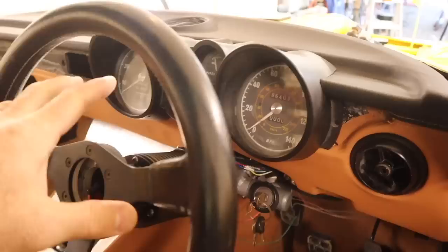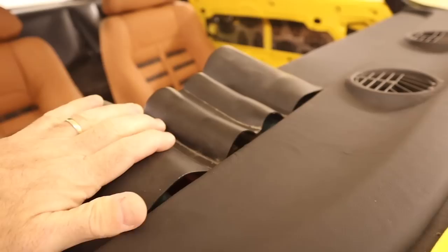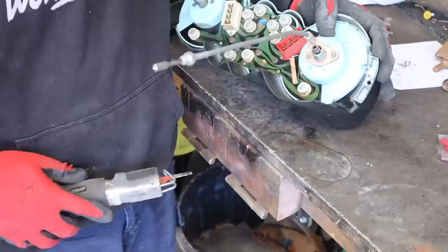The dash is in - I pulled the steering wheel off. There's more to come on the gauge cluster later, but the actual surround itself is all warped. It's a very common thing with these - the warped cluster never really lines up well with the back of the dash; it's always a bit open and not amazing. You can get reproduction gauge clusters, but what I want to do is build a panel trimmed in leather that sits over the top, blends it into the dash, and makes it a nice neat leather-clad part that won't have the same issue. Let's make a template.